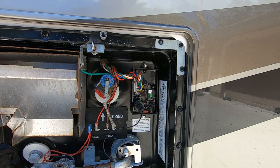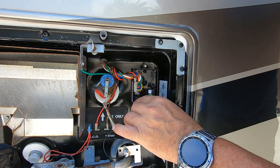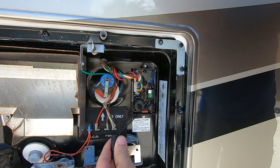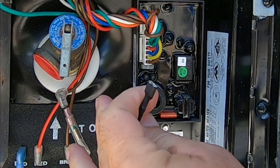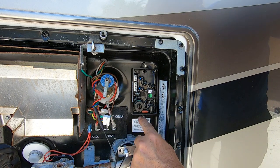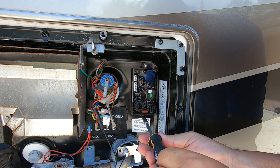So let's bring you in. I'll show you the board that's giving me a problem, and let's replace it. This is the inside of the Atwood water heater, and you have three connections: the sparker, an igniter, and you have a four-pin plug and a six-pin plug. The first thing we're going to do is pull the rubber boot off the ignition board — it's just a little spade bit, just like that. Then you have a four-pin plug and a six-pin plug, and they just pull straight out. It's held on by two small screws — get them out of the way and this board will come right off.